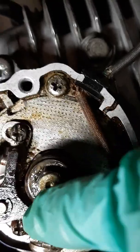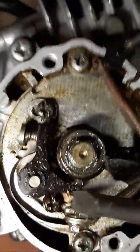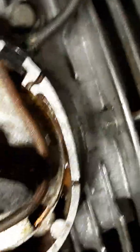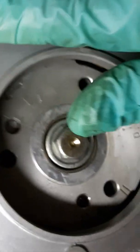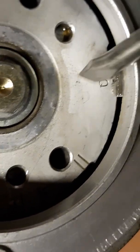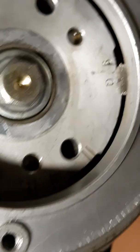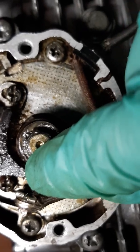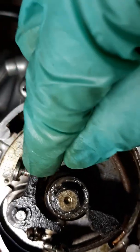To get this highest point on the cam — that's the cam right there — what I found out is on the flywheel down here, below the engine, if you look closely you'll see different markings. This zero mark right here is where I get the highest point on the cam, giving me the biggest opening on the point gap.